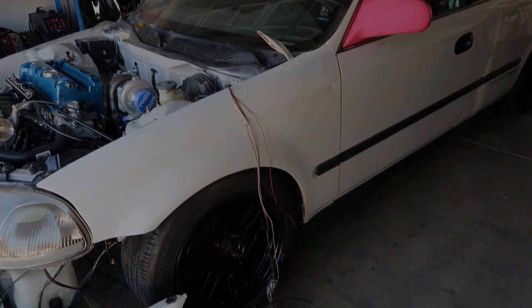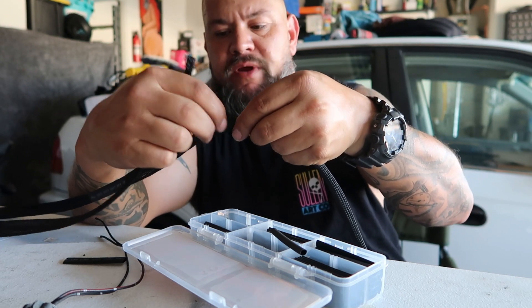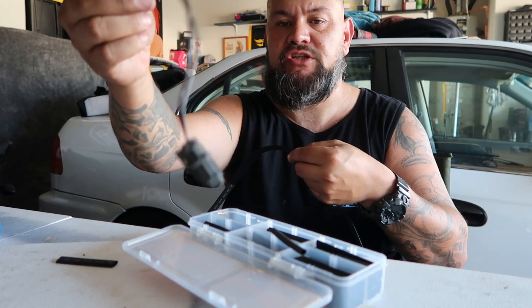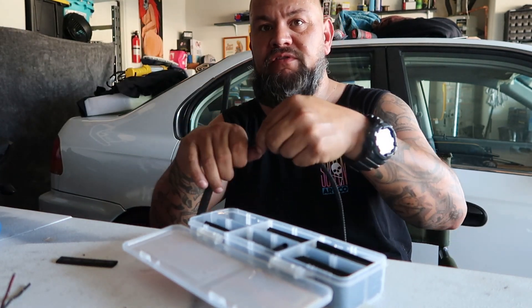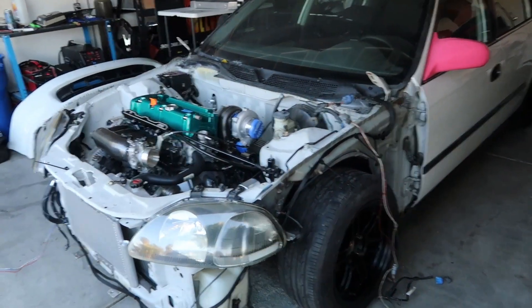Alright guys, I just started here. I did cut the wires off. What I'm going to do now is make a snip here in the middle of this section so I can get the wire I need, which is basically the negative side, and then fish the other side back in. I can merge them both in but I still got to put wrap over this one. I'll show you guys how I merge them together so it covers it up and holds it. Like I said, I'm not a professional — this is just the way I'm going to do it. I've done it before and haven't had any issues with it.